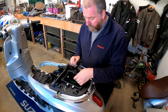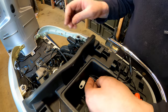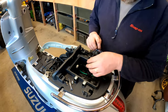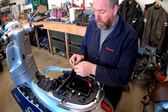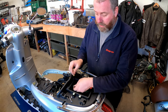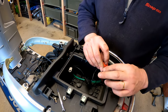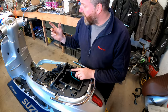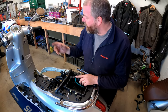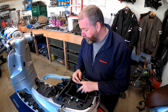After much fiddling, the cable is now coming into the battery box. As you can see, there are two cables coming in here: one for the Optimate and one for the grips. I've put a little grommet in there to prevent chafing on the side of the plastic. We've now got two extra cables going to the negative terminal — one for the charger and one for the grips — and the two positive ones are on the positive lead inside that little boot. I'll get the battery back in and then we can give the grips a test.